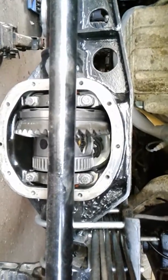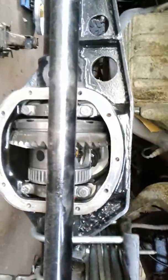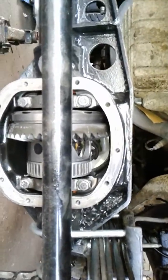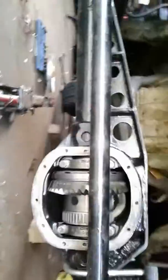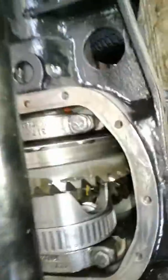So that's it for the diff. Like I said, if you're interested, there's a bunch of videos on YouTube on how to do it, but this is one showing it's been done — a year later, it still works. It's getting new gear oil and a little bit of posi additive, just because the G80s and the Chevys weren't known to be tough. This truck had one in the rear — it's an 8.8 back there now. Everything's got its limits. This is a Dana 30 with 35s and 4.10s — that's as far as I'm going. For me, it works.